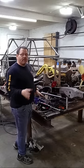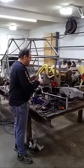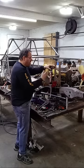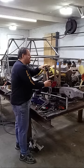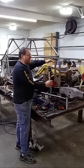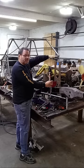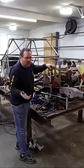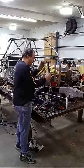And it will be a compromise, because what I'm going to have to do is say, okay, what's optimal for the right front? What's optimal for the left? And then I'm going to see, can I run the two at exactly the same height and make it parallel across? Maybe this one's a little higher and that one's a little lower than it has to be, or vice versa or something like that.